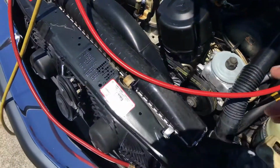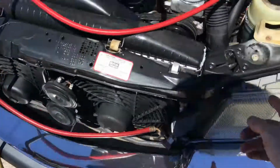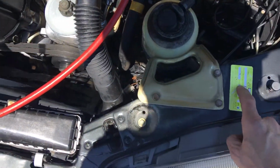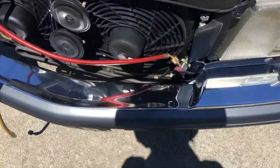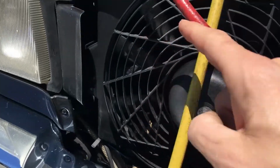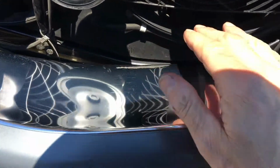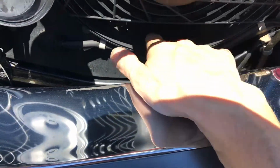Got to break out the electronic leak detector. It's your first and prime use. I will break out the UV dye because somebody put it in here, even though I know the guy who steam cleans these systems, he steam cleans everywhere. I don't find any oil residue when I'm looking up inside on the fins. There's no dirt, road grime or nothing, even on the condenser fins there. He did a really good job of cleaning.